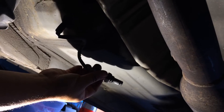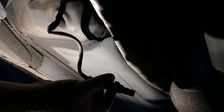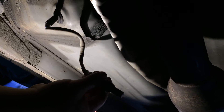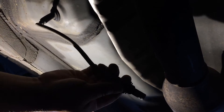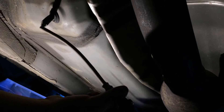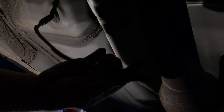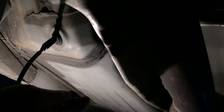When I removed the rear O2 sensor I had to twist the wire, so when you go to reinstall it make sure you twist the wire up a little bit before installing it. If you don't, it'll just twist itself when you're tightening it up. So put a little bit of twist on the wire before you install it. Here's my O2 spacer with the crush washer on it.